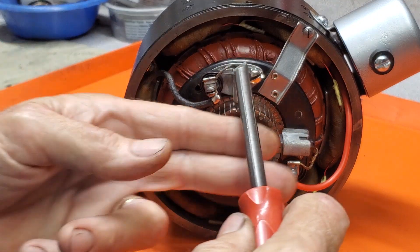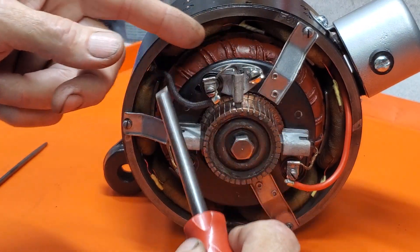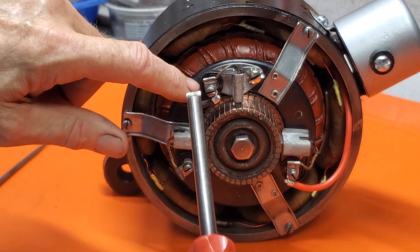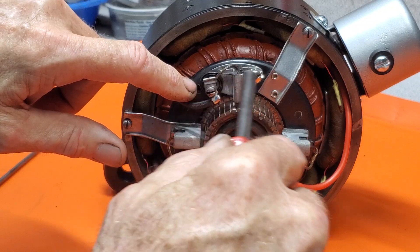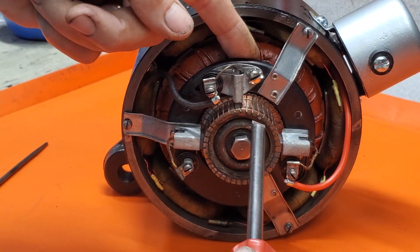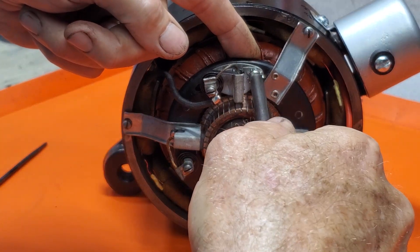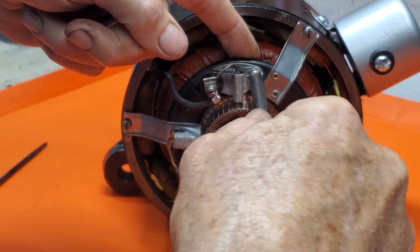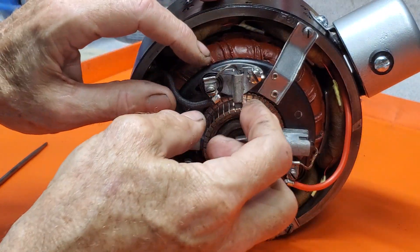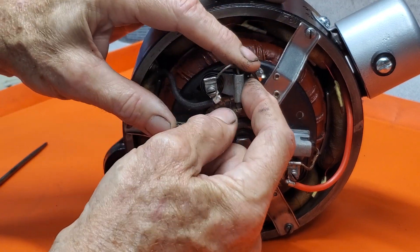So it's simply you have a screw right here. Now the important thing to remember is these Bakelite rings are fragile. Bakelite is an early form of plastic and the weakest part is where the slot is cut in them, so there's less material and it's kind of weak. So always put your finger behind the screw supporting the back of the Bakelite so when you're pressing in on that screw you're not putting pressure on the Bakelite ring. Just loosen that screw maybe one turn — that's all you need.